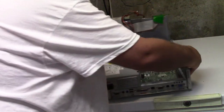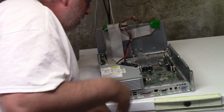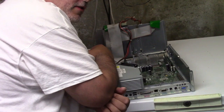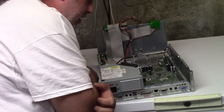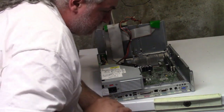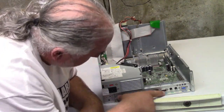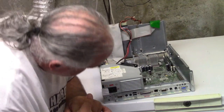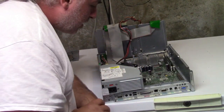There's really nothing to see — there's your Pentium 3, it's a slot chip. There are two sticks of RAM, each 64 MB. I don't have any 128s but I'm going to look before I put this thing back together. 128 does serve it, but not well. It does have onboard Ethernet and two serial ports, which is a big plus. Now we have to get the power supply out, and chances are that should be tool-less. There's a diagram here — it says no screwdriver.